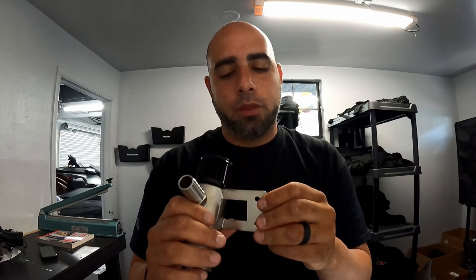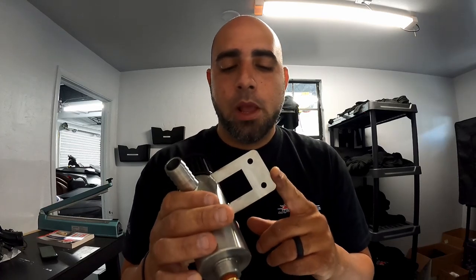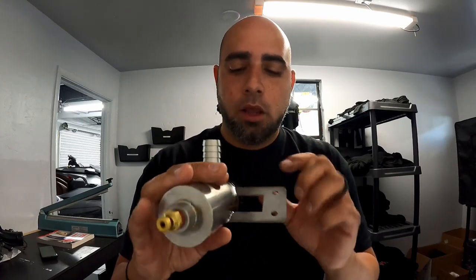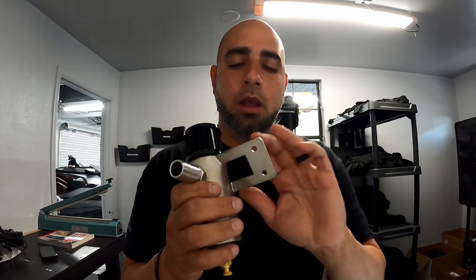Another thing that was happening with these is once we got our bracket on there, our bracket was a little thinner than this in the beginning, and it kept breaking and cracking off. So I'm pretty sure since then I've replaced all those cans for everybody when they've failed. But now we use a thicker bracket, which has welds on the front and on the back. So we've pretty much eliminated any of the issues with the brackets breaking on here.